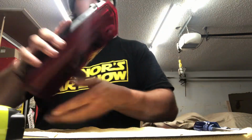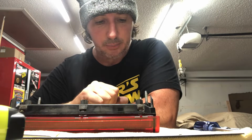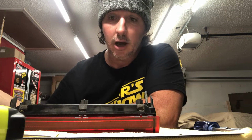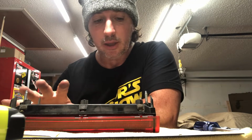So if you're into working on your stuff and changing your stuff up and you want to take on this project, it's very simple, very straightforward. There's a couple ways to do it. Like I mentioned, some people posted on the forums that you could bake this in the oven and pull it apart. I just used a heat gun both times and it worked just fine. Don't overheat it. You don't want to melt anything.